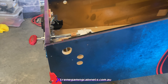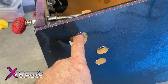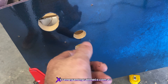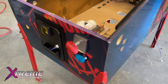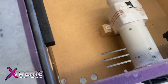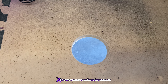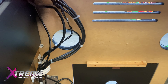We've now drilled all the extra button holes. We've got our magna buttons - we had to make these holes a little bit bigger, which you won't see once the buttons and side rails are put on so it fits correctly. We've got our half-mute and push-together full-mute sound system button. On the other side, we've got the left magna button and the two holes for our volume up and down. We've drilled the hole for the fan, and the other one is for the power supply which also has a fan, blowing out here.